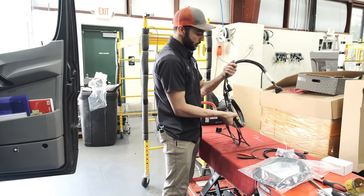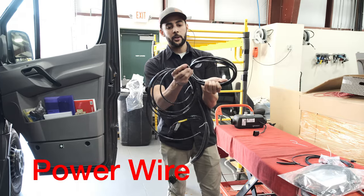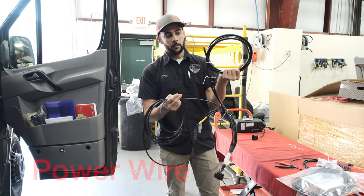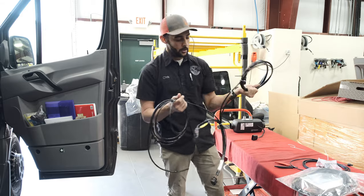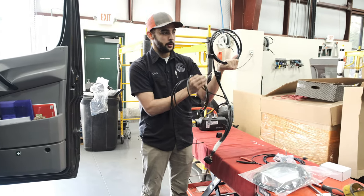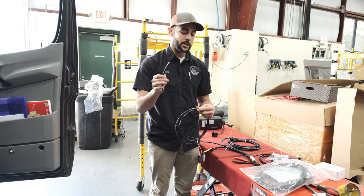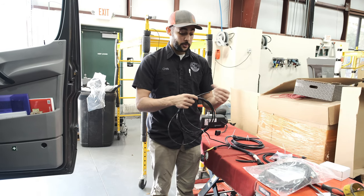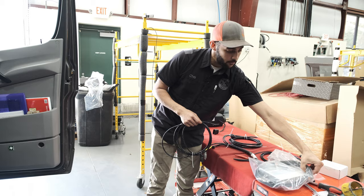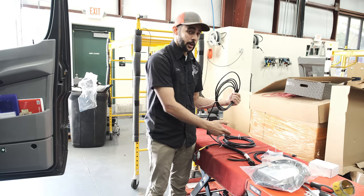The next wire is the power wire — it'll have a red and brown wire sticking out and is one of the thickest parts of the harness. That's where you're getting power to your heater. Attached to that wire is the fuse, so leave it zip tied and don't touch it. The next wire — the second longest — is the Digimax D1000 control unit wire. For this scenario we're not using it; we're using the Easy Start Pro instead. So we're either going to tuck this to the side or cut it and not worry about it.